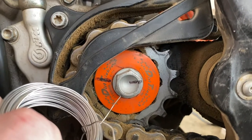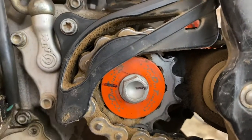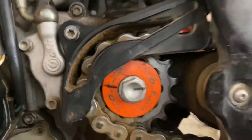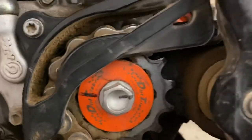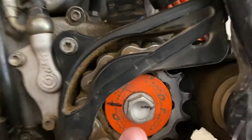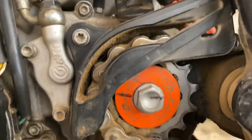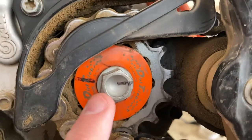I will safety wire this bolt in place so it can't actually come out. If it's loose, it will leak a little bit of oil, because the way this seals in the engine it requires tension in the dome washer to work properly. I'll notice some oil coming out if it gets loose, but if it comes out entirely that can be very dangerous. These are race bikes meant to be ridden hard — I don't know why this design doesn't already account for this.